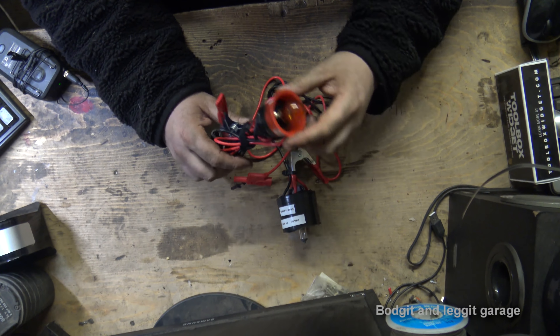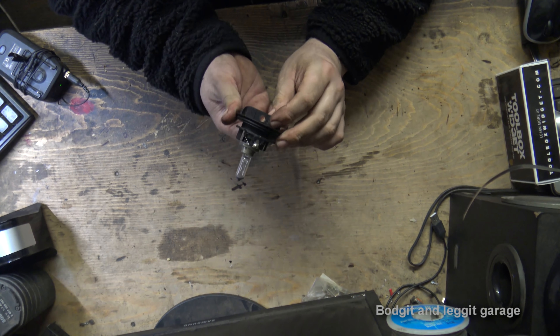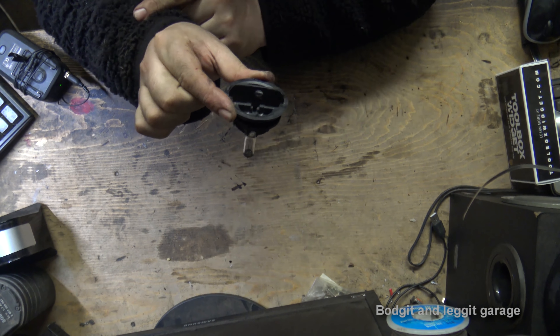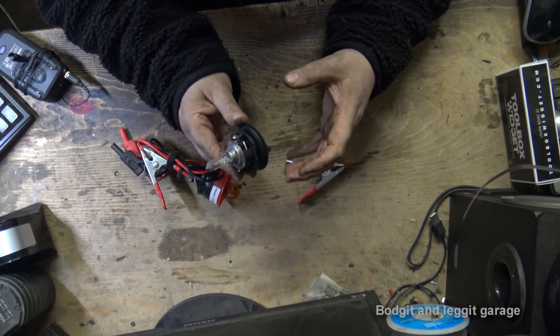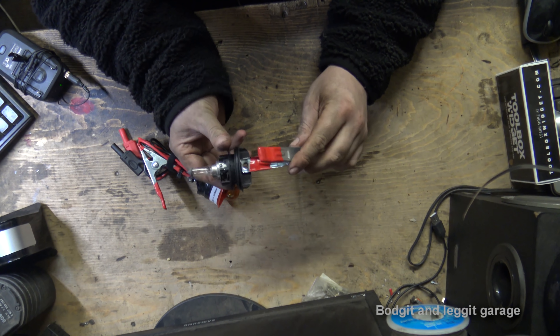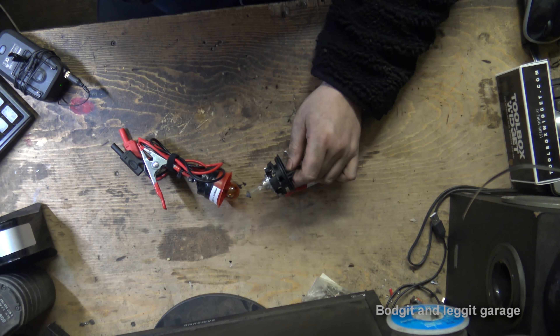This is what I like to use — it's off a Vauxhall Corsa and I like it because it holds your H7 bulb. It's got a nice plastic surround but it also has these wide tabs at the back, just like this other one which is also from a Corsa indicator. I like the wide tab because you can put a clamp on it. Rather than just running wires — which works but that's when you can burn things — I prefer the slightly bigger tab at the back. These Corsa ones are about the best use I've found for a Corsa, to be honest — making test light bulb holders.